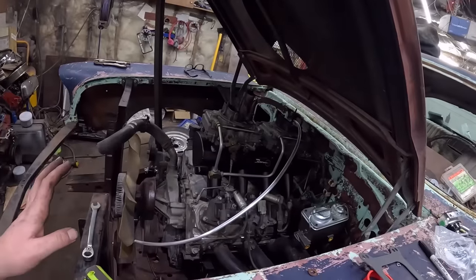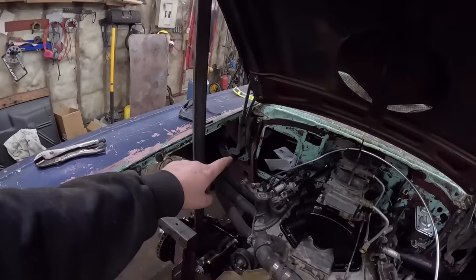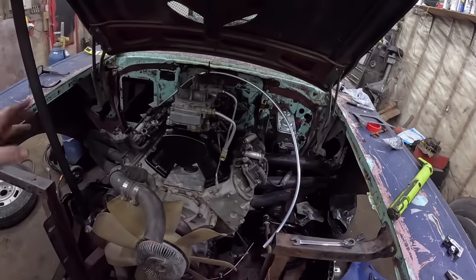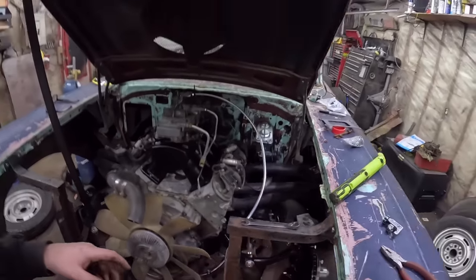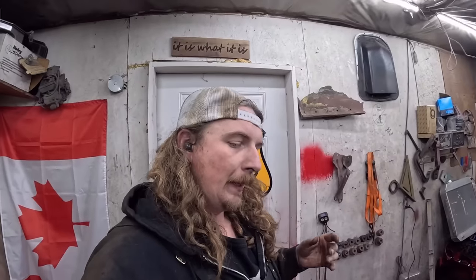The headers fit good. Everything has to come apart yet. I realized when I was under there, these pink braces actually hold the front of the body down. They're not welded to the floor yet, so I have to do that. So headers have to come off. I haven't welded the steering shaft. There's still lots of stuff. I did weld the motor mounts in, because that's all taken care of. But this is a bit of a slap it all together and take it apart. Again, fender well headers, LS, tunnel ram. I wouldn't say it hasn't been done, but you can't just go out and buy a kit for it. And typically, you have to fabricate it, take it apart, put it back together, and keep giving her. But yeah, we're making lots of progress.